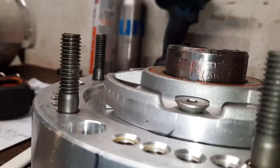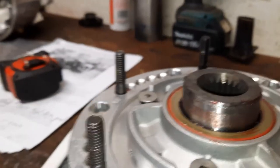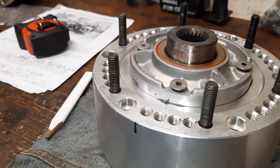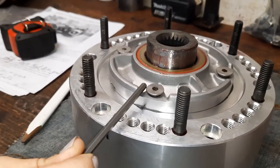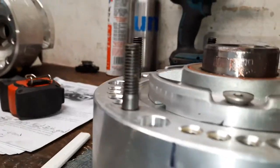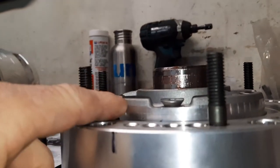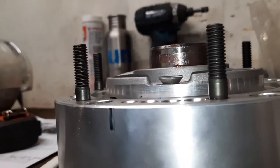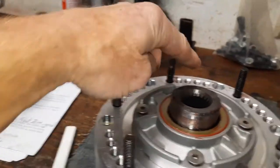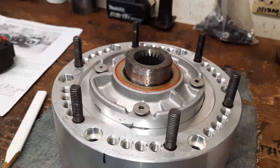If you look from the side, we had to grind it off like that. Also the bolts that they gave us for right here, they were hitting the inside of the transmission. So we have these bolts on there — they're low enough. The bolts have to be lower than that point that hits. So we had to grind off three places on the bearing retainer to get it to fit, but it fits nice and tight now.